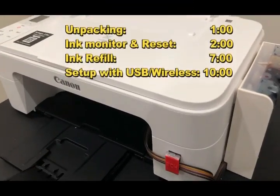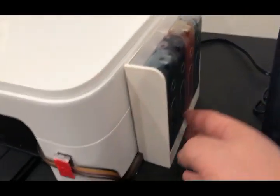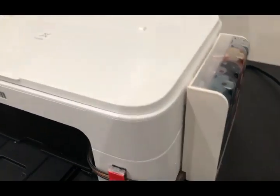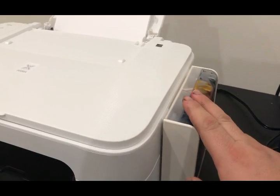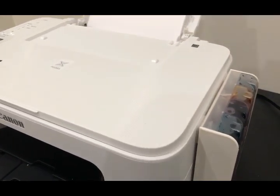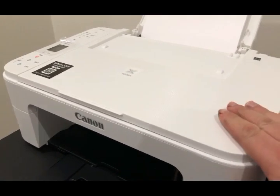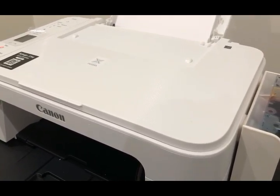I need to talk a little bit more about the ink levels. There are two ink levels. One is the actual ink level — and the actual ink level has about 20 to 30 times more than what you need. But the printer has an ink monitor that doesn't know you have this big tank. So the printer's ink level monitor is going to run from full to empty as you print. So no matter what you do, you have to let that ink monitor go empty.